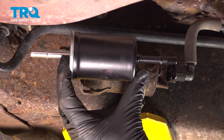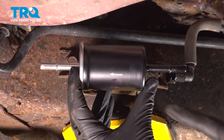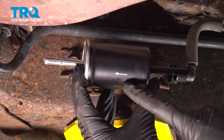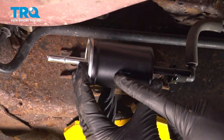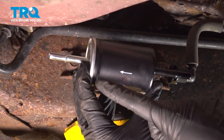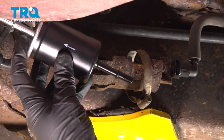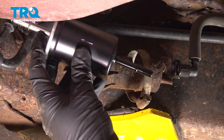Let's get ready for installation. Have a look at your brand new fuel filter — you'll find that it has an arrow. You want to make sure that arrow is facing up towards the engine; that's the direction of fuel flow. Carefully put it in place, bringing it down diagonally from the front towards the rear.